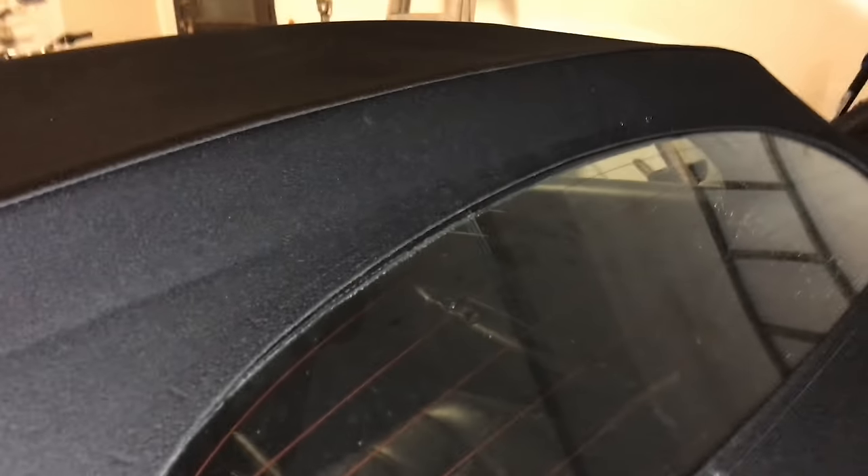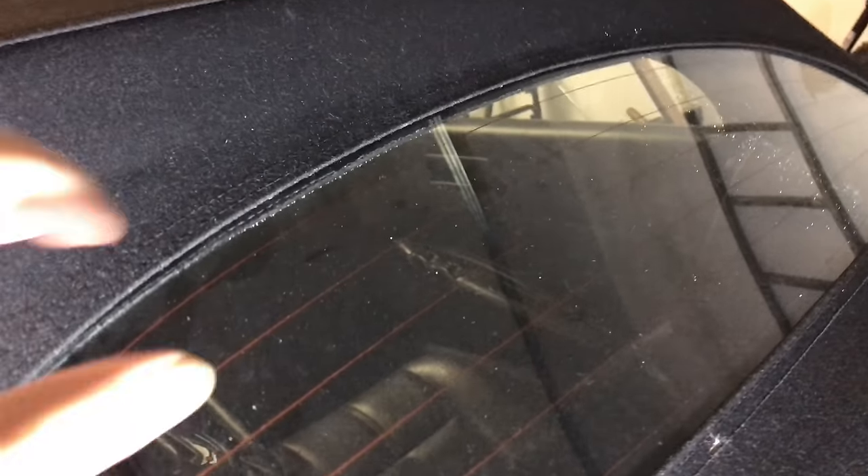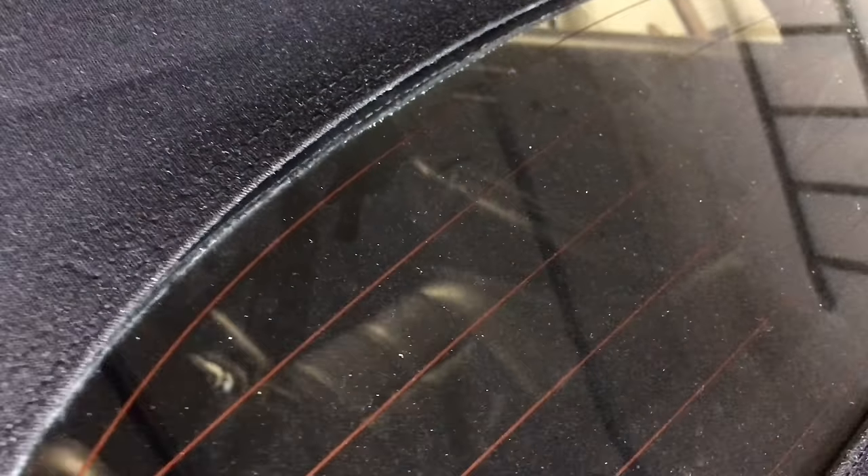You can see here we've got ripples where it should be nice and tight. The reason is I've got the clamp down there - I've got some delamination, it's separation of the convertible top from where it is essentially fused, kind of like welded or glued to the glass. Mine goes almost all the way around.